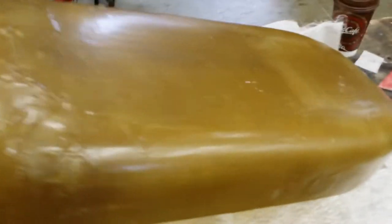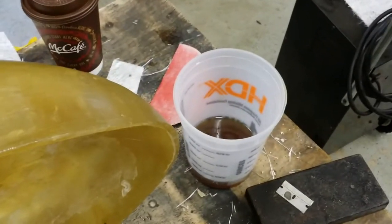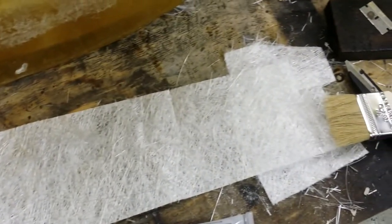Today, what I'm going to do is fix some of the air pockets that are in the hood. There's a couple big ones, so I took a Dremel tool with a little burr and I just bored out the air pockets. We'll fill them all in with some resin. I got it poured, I just got to put the hardener in it. Got my piece of mat cut with the relief cuts all set up, so it should kind of just drop in there.